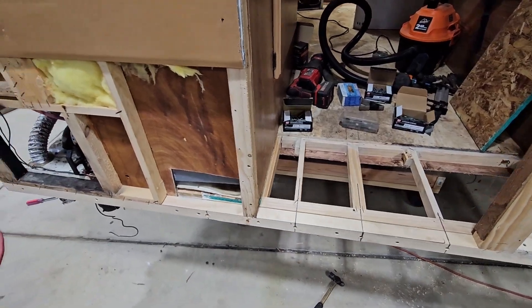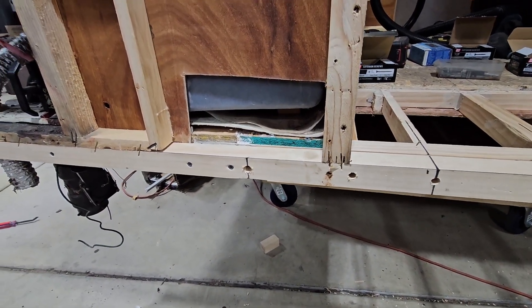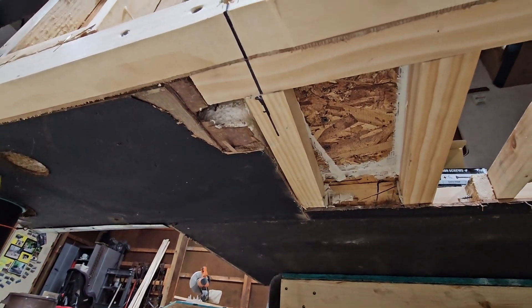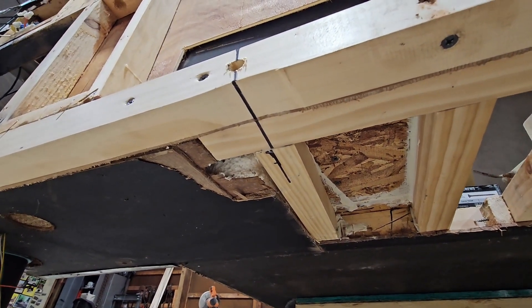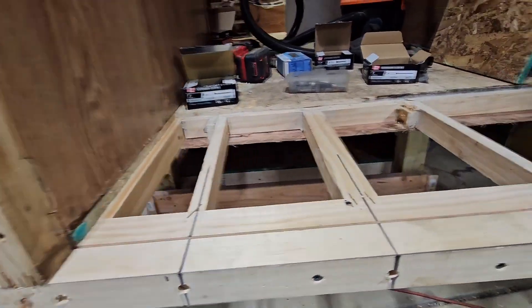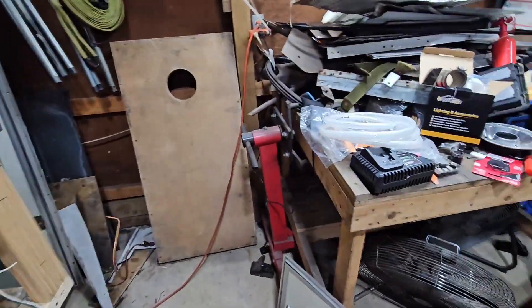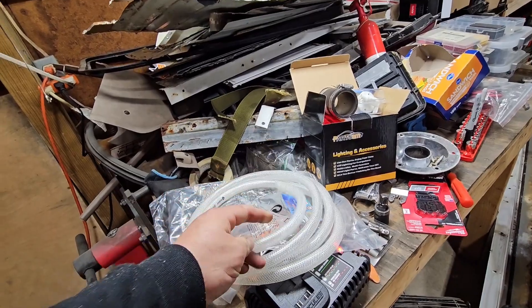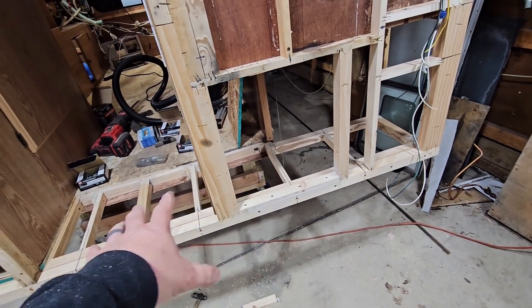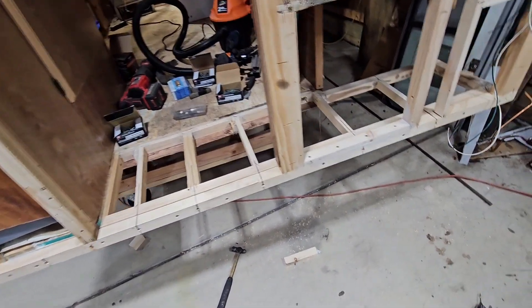Moving on — I took care of this piece of patch floor, roughly seven by ten inches, liquid nailed in place. I did have to add one more floor truss because that side of the patch had nothing to go on to. Everything is screwed and liquid nailed. I went ahead and cut that piece of floor. Unfortunately the hose I bought — I only got a 10-foot roll but I need 20 feet. I can set the floor in place for now without screwing or gluing it, then move over and work on the wing.